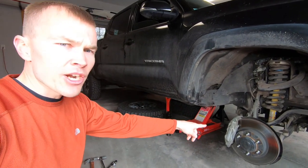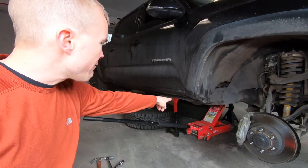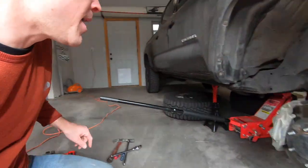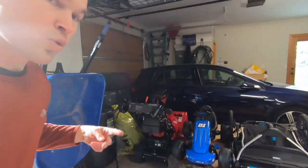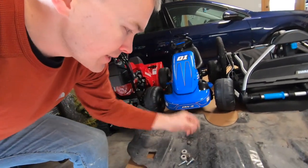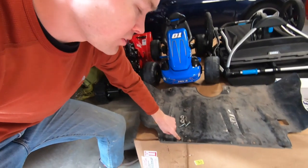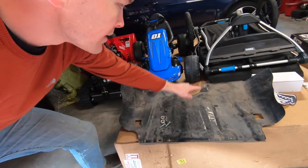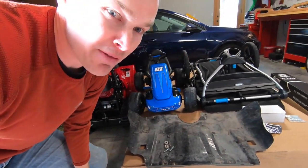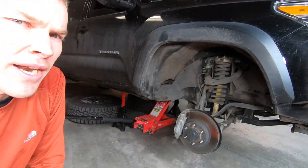The first step is to get the wheels and tires removed from the vehicle, so get it lifted up on a jack and pull those off. Make sure you've got jack stands as a secondary precaution. The next step is to remove the skid plate up front. To remove it you need a 12 millimeter socket and a 13 millimeter socket — there are two bolts up at the front and two at the rear, plus two little hooks at the front. Remove those four bolts, then gently lift it up off the hooks and remove it from the bottom of the vehicle.